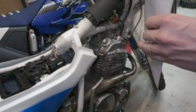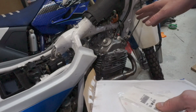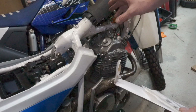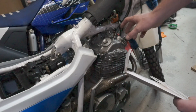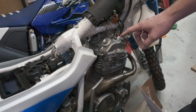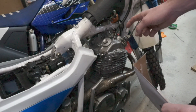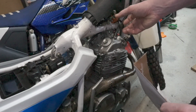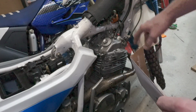Right, so the last few clips that you saw were about 2 or 3 weeks ago. So this is my fault really, but the cam that I've installed is all right. It's the right fit and everything. It's missing one component. You remember I was looking at this one-way clutch thing on the camshaft. Well, that's actually an anti-kickback device. In normal operation, the cam is able to spin that direction freely. And then when you get a kickback, it'll actually rotate part of the cam to open the exhaust valve. It only works like say half a rotation, and then it'll activate the exhaust valve so you don't get a kickback.